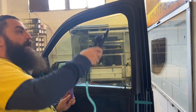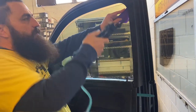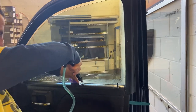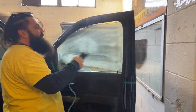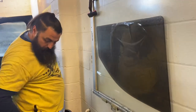So we've got that. Now we want to squeegee all that — this is the final. I'm going to take my squeegee in here and just work it down, continuing all the way. We want to make sure underneath that seal it's plenty wet. This is a bottom load video — for bottom load, you've got to have plenty of slip. But it's not just how much you spray; the slip itself has to be enough.